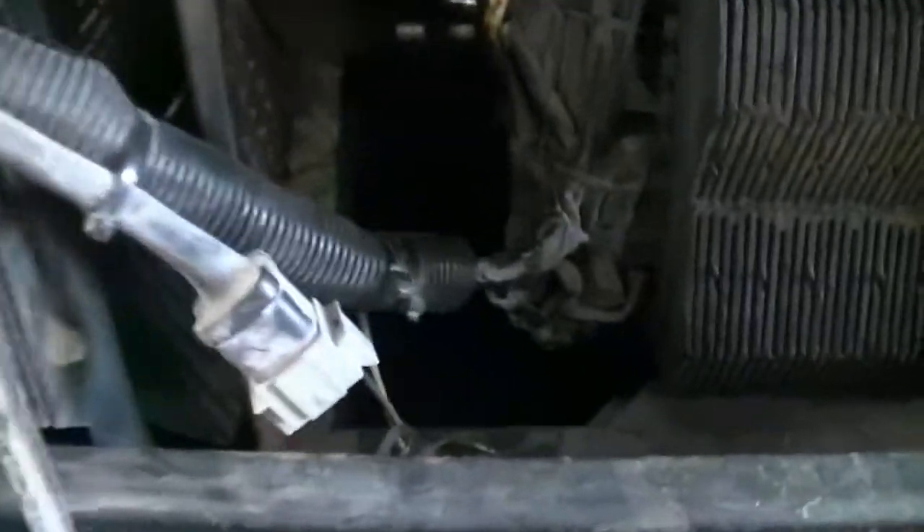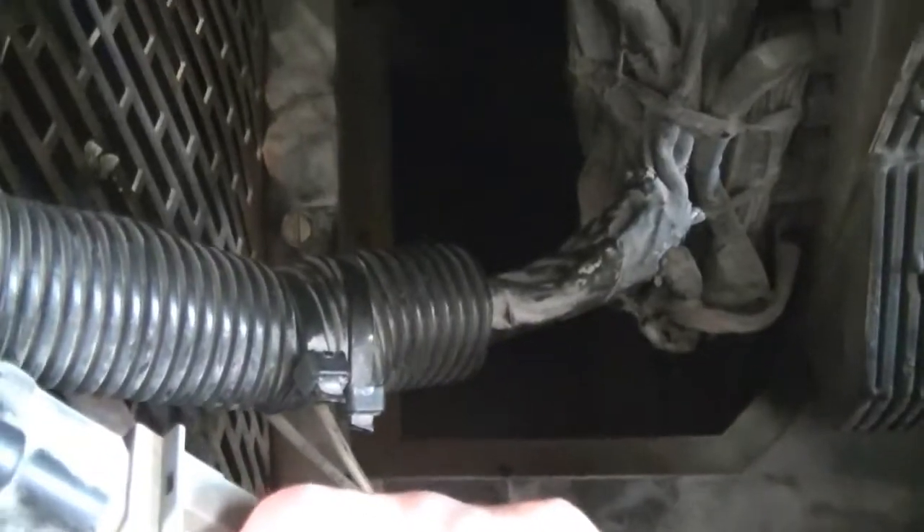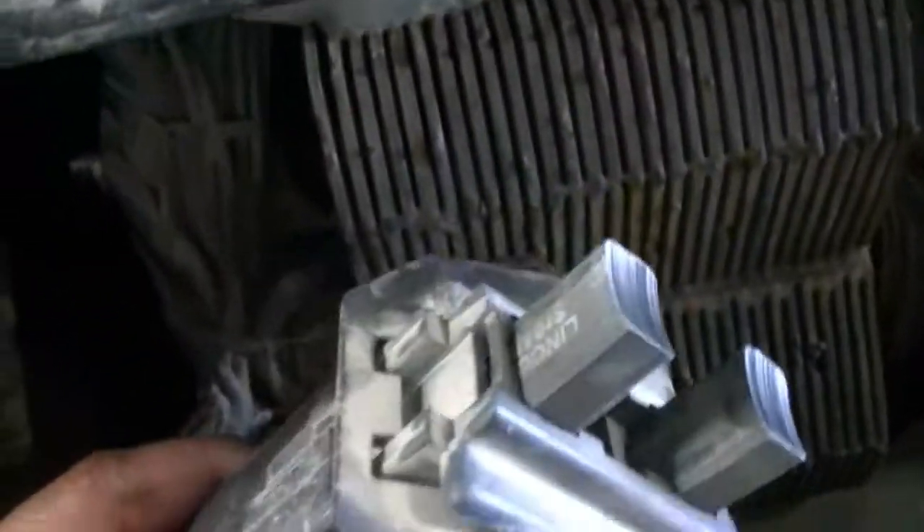That's flashing voltage that goes down to your brushes. Your brushes are bolted down here to your stator, and your brushes press up against your slip rings there. I already pulled the brushes off — brushes are good.